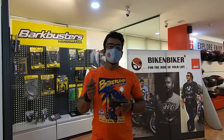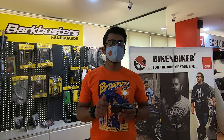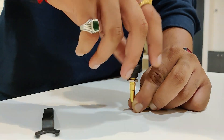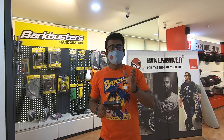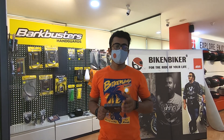Installing on the motorcycle is quite easy. Take off the current air cap on the motorcycle and put in the anti-theft nut first, then put in your sensor. Once you do that for both your wheels, you should have a reading on your phone showing the current PSI inside your tires. Note that there can be a plus or minus 1 or 2 PSI variation depending on the current temperature of the tire.